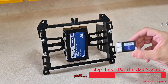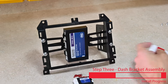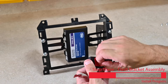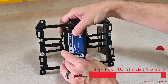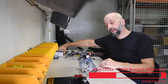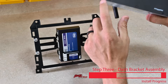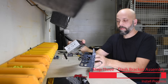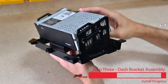Now take the Pack Link module and use a piece of the included double-sided tape. Apply that to the back of the Pack Link and stick it to the front of the RadioPro Advanced module. Now we're ready to take the brain of the Stinger infotainment unit and mount it into the mounting bracket. Holding it with the logos facing up — navigation only and SiriusXM — slide it into the back of the bracket. It's going to sit right on the back of the RadioPro Advanced module.